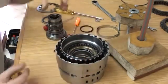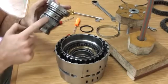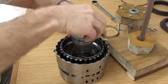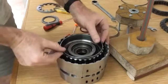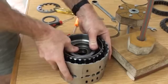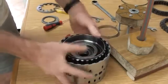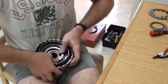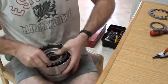Then I'm going to put the freewheel down and just roughly centre it. The difficulty when we put in the freewheel is we've got two O-rings, and pushing those down whilst splined with the centre portion of the DG drum is a little bit difficult. So I'm just going to gently push that down — you can see that's the first O-ring that's gone in, but it still isn't down to the sprags yet. If I then just gently wiggle it a little bit further, now that's actually gone down to the sprags. What I can do now is just sit it in my lap and gently turn and press, and then she pops.